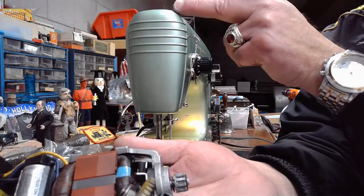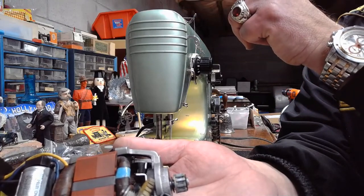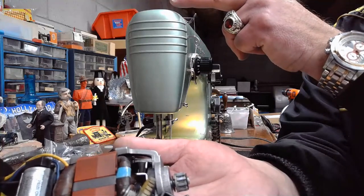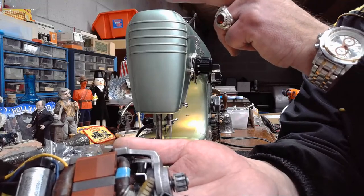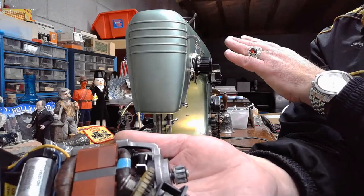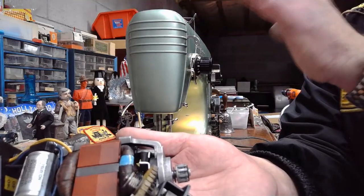You always want to launch with a Swedish Beauty, or any machine for that matter, where it's at the pinnacle of the high point for that take-up arm, and it's almost on that downstroke. It's right where it's about to go into that downstroke, because then it frees up the mechanics of that machine with no binding, no resistance, and you get a real nice launch.